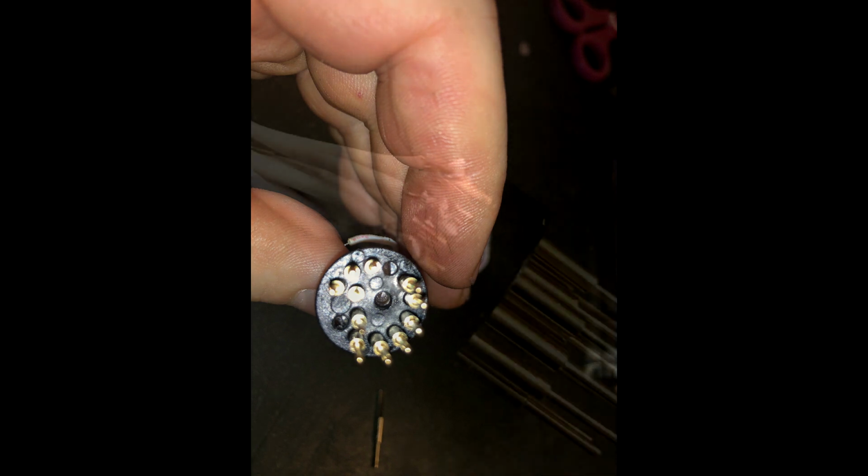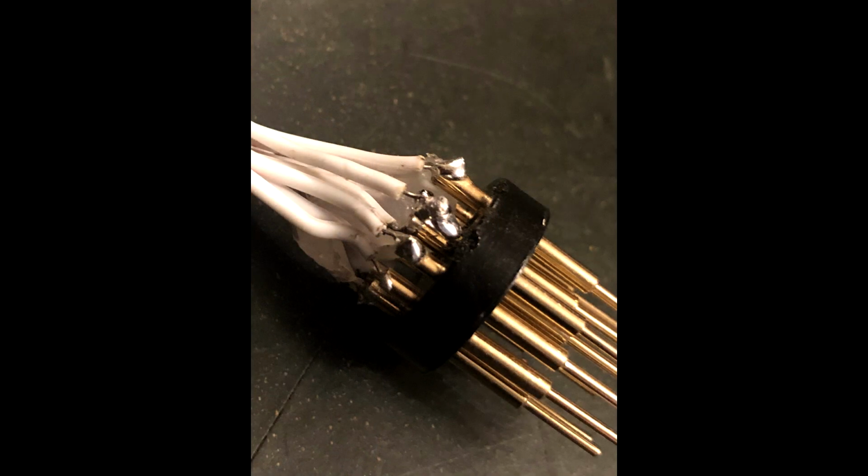This shows the plug now missing 2 pins, the redundant one that we've borrowed and the broken one now removed. This picture shows how bad my soldering is. We've passed the redundant pin that we borrowed from another slot into the slot where the broken pin was and soldered our wire back onto it.